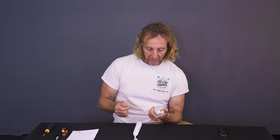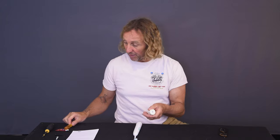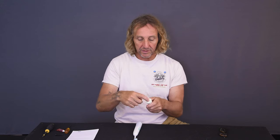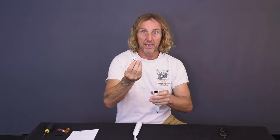So let's do it. Take off the head, and pretty much what we do is get this bottom part off. I thought maybe it was a label I could peel off and there'd be some screws there — there wasn't. Instead of prying it off with a screwdriver and tearing this thing up, what I did was I just got a standard quarter-twenty bolt, one of the most common screws available. This little charging port here is plastic — it turns out that screw fits in and threads in there pretty well. It digs into the plastic a little bit. Just push it in, don't turn it too much. Turn it just enough to get it snug and then pull — and the back comes off. You don't have to damage the unit at all.